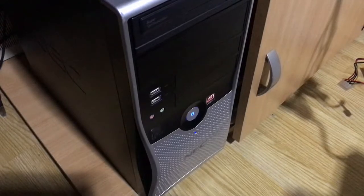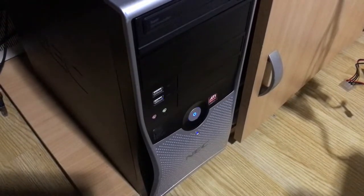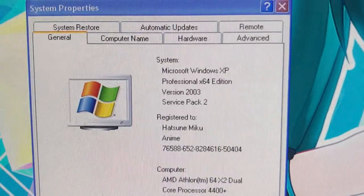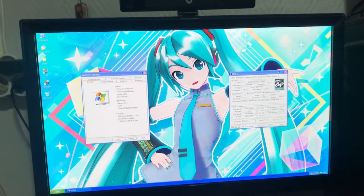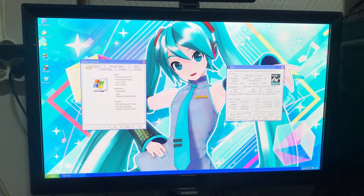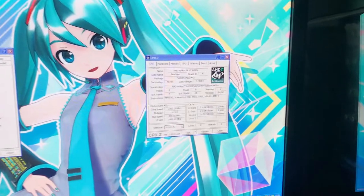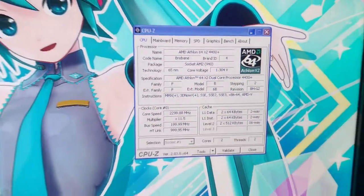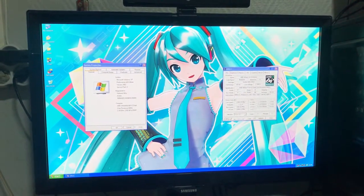And that concludes the benchmarks for the NEC PowerMate VL370, a 2008 business machine. So, even though you have a business machine, I proved to you that you can turn this into a Windows XP retro gaming PC. If it is not powerful enough with the stock components, you can still upgrade them. You can upgrade the power supply, you can upgrade the CPU as well, and also since this is Socket AM2 Plus, it does support some Socket AM3 processors, but I just put in the stock CPU, the Athlon 64X2 4400 Plus,